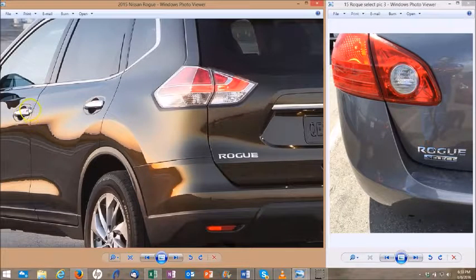The ignitions look different, the dash behaves differently, and the keys obviously are different. If you have a key to the newer Rogue that's already working the vehicle, it's going to be the flip style key with the Hitag 3 chip, which is not reusable, by the way. So be careful with that one. As opposed to if somebody presents you with a Rogue Select, you'll know immediately because it uses an N104PT key. So that's the distinction between the two as far as the keys.